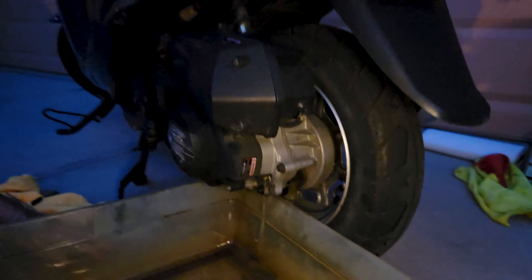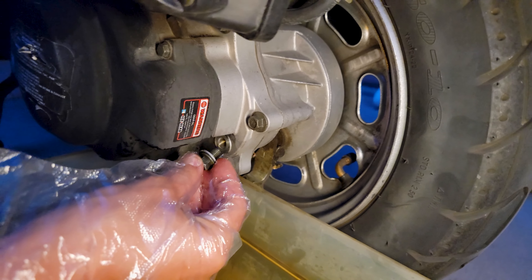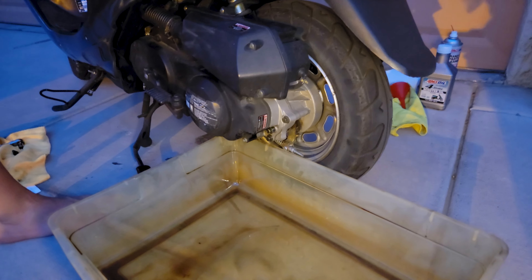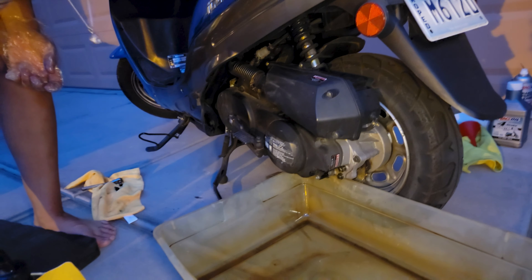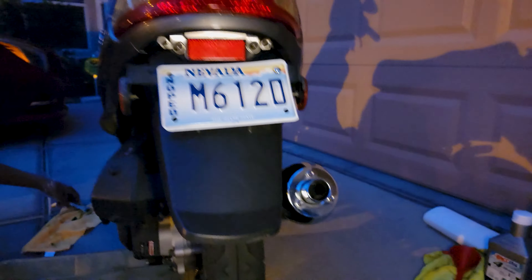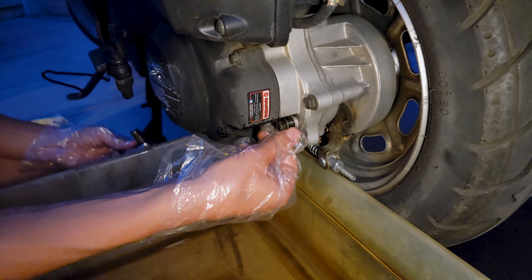You don't want to overfill and then put the plug on because it can overheat. So we cork it off and level it completely. When your scooter is on the center stand, if the back wheel is touching that's not level, and if the front wheel is touching it's also not level — both wheels should be hovering. We're going to shove a kneeling pad underneath the tire to get it hovering level. Now we'll take the plug off and let it drain until it stops overflowing. It holds about 0.25 liter — basically just over eight ounces. Wait until it stops overflowing, then cork it off.